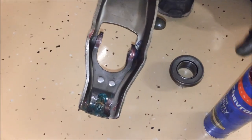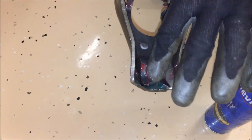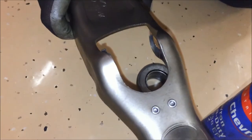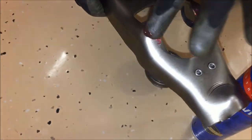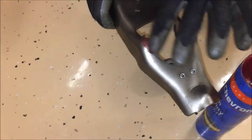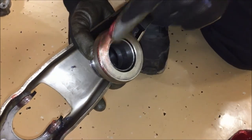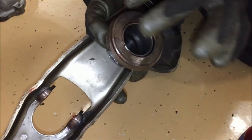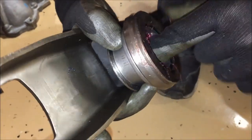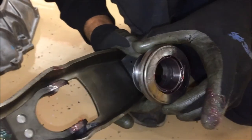There are several places we're going to want to grease the clutch fork. Put some grease on the actual forks here and here, and make sure where the pivot ball goes has plenty of grease as well. On the reverse side, put some grease on the very top of those little hill areas on both sides. On the throwout bearing, put some grease on the face of it where it's going to be contacting the diaphragm fingers, and also put some grease on the inside of it for sliding back and forth on the retainer sleeve.